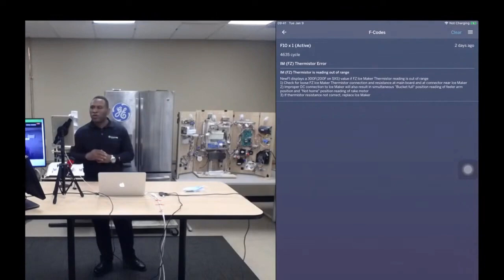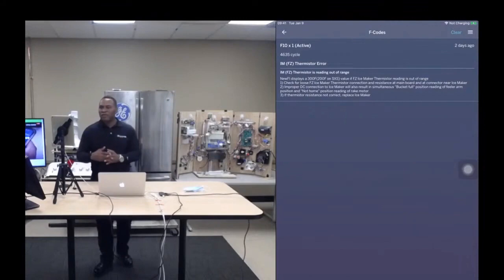So in this case, it happened 2 days ago. And then, is the fault code active? You know, some issues are intermittent. So this tells you if this fault is still triggering or if it's dormant and has kind of gone away. Okay.